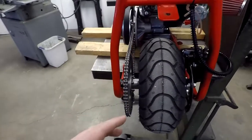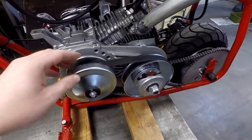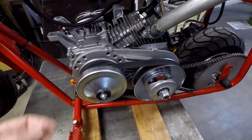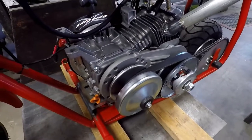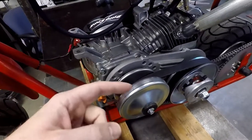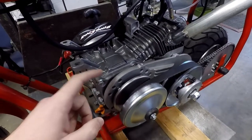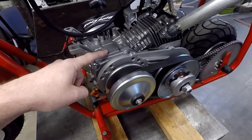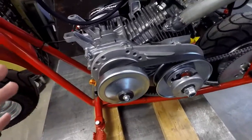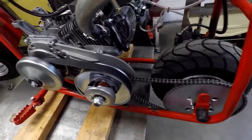What we're going to be doing today is switching out the sprocket in the back. We also added a 30 series torque converter — this is off Amazon and was like $70. The quality is pretty decent. The bolts that mount this bracket to the engine are coarse thread, but I believe the side plate is fine thread. I was able to tap out the engine, but I noticed these bolts are now loose after running it just a little bit. So I need to put some lock washers and/or Loctite on it.